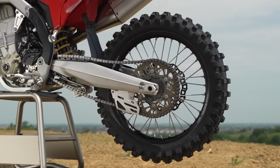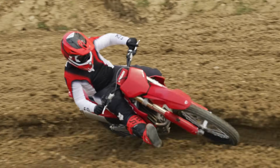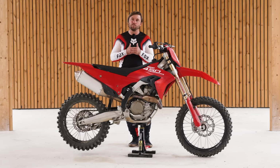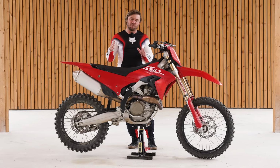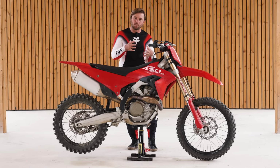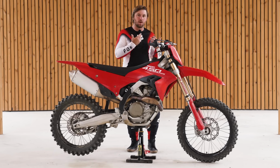So the really, really tight sections on this track, I was struggling with second gear, feeling too low RPM, a little too chuggy and not quick enough responding. Because even though I said it would rev quickly, that's from about 5,000 to 6,000 RPM and up, but that bottom 2,500 to about 5,000 is soft. Again, soft torque there, soft RPM feel. So if you really let it lug down in there in really tight corners on second, it would take a second to come up off that bottom.